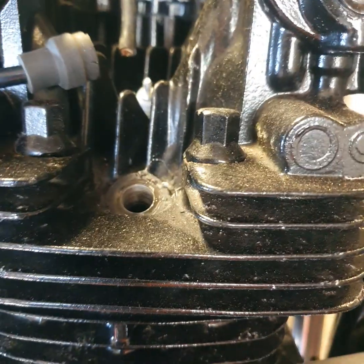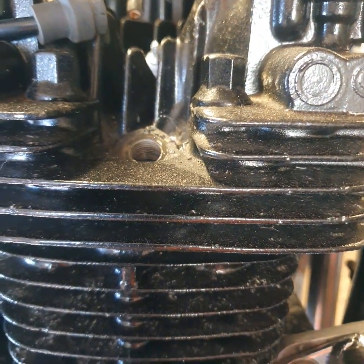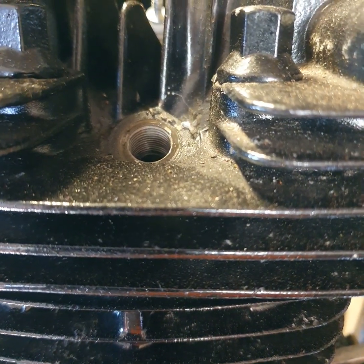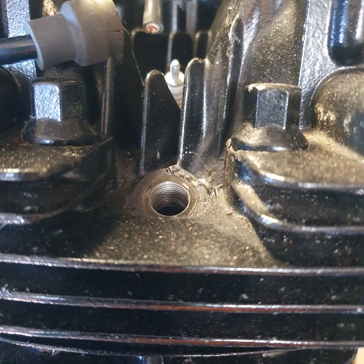I always take the plug out as well and just check that it is on that cylinder — just the secondary timing to make sure. Put a very small flexible rod down there gently and just make sure the piston's right at the top at the same time. Don't leave the rod in and don't put the rod in when you're turning the engine over, because they can jam. Just use it as a reference point.